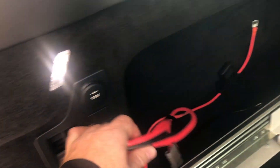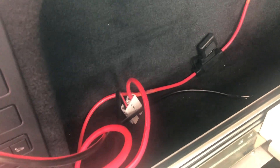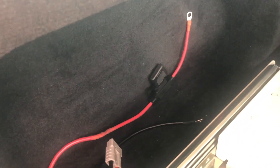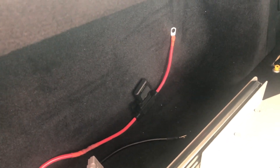Got a lot of wiring coming up through here. The battery — I've still got to think about how we're going to mount that. We have put in a brace underneath the floor to support more of the weight, because this false floor is on gas struts when it lifts up, so it can't really be bolted down against anything and has to be allowed to move. That Anderson plug is just for solar — for the rest of the things I'll probably put in a fuse box, but we're really only going to run an inverter and a fridge back here.